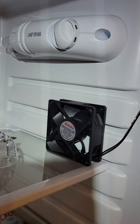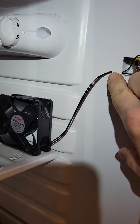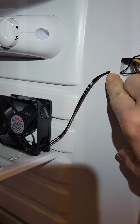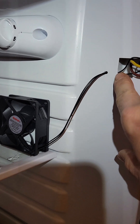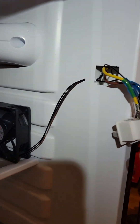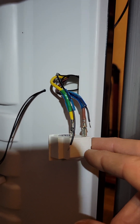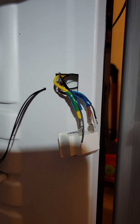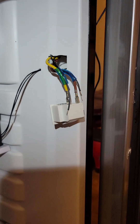Here's the fan — there are little wires that come from it. I've already tested it at 110V; you can wire it either way because it's AC, and it even says so in their sheet. I drilled a small hole here so the door switch can slide in. I've routed it through here and I'm about to solder these two together onto the terminals, then put it back together.